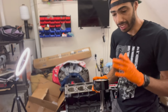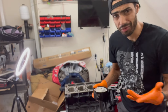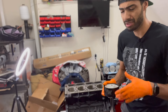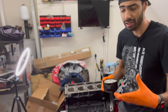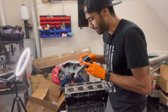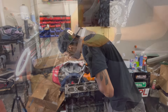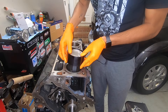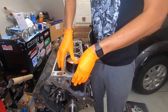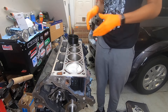This is the Summit Racing Ring Compressor. I'm starting to really like these tools versus the old ratchet-style ring compressor that I'd used in the past. I found with the ratchet-style ring compressor I was constantly having to crank on it and adjust on the fly — I couldn't get the pistons and the rings to compress evenly. But with this it just makes life so much easier. You just kind of feed it through. I had to get enough of the skirt out that it can line itself up inside the cylinder. This is why we lubricated the piston walls before. Boom — straight shot in, on the money.